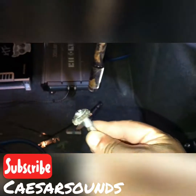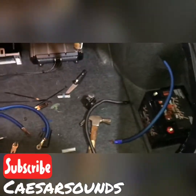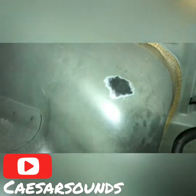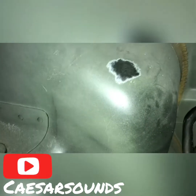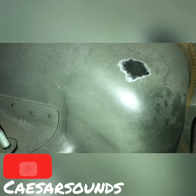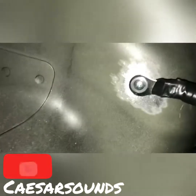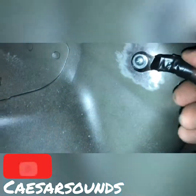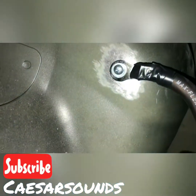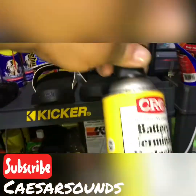Use this wire brush to scrape back to the bare metal, get a self-tapping screw — about two or three of them — put it in there, and hopefully the battery will be grounded. Got my paint scraped back, that's where I'm going to ground this wire for the battery. I'm going to use these self-tapping screws and some battery terminal protector for corrosion. Got my ground made — paint scraped off, self-tapping screw to the washer — and I got the spray on there so it's protected from corrosion. That's it.